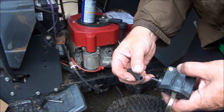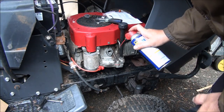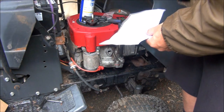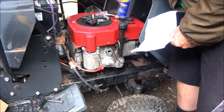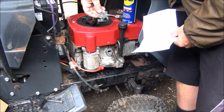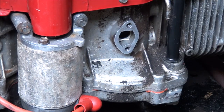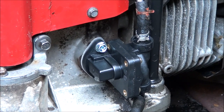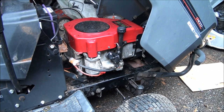I'm going to put this fuel line on first — brand new fuel line. It's a bit confusing because the instructions say to just use the O-ring, but the kit also gives you the spacer and a gasket. I couldn't find any information about whether that spacer goes on, so we're going straight off the engine block with the O-ring directly to the fuel pump. Let's see if this thing will start.